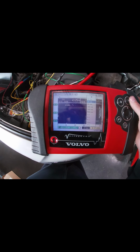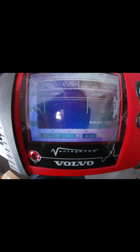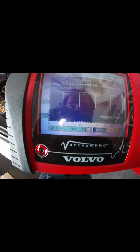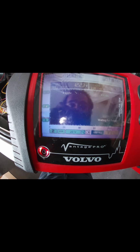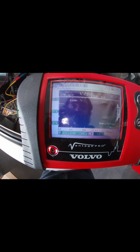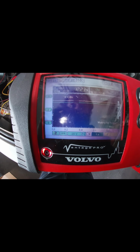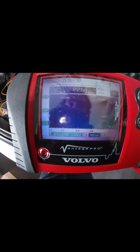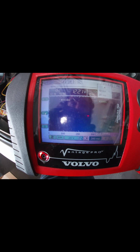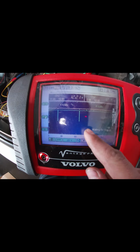Even when I bring it down in time base, 20 milliseconds then I start getting it. 50. You go to 1 second and it's not there. 500, not there. 200 milliseconds, then you can start to see the hash.